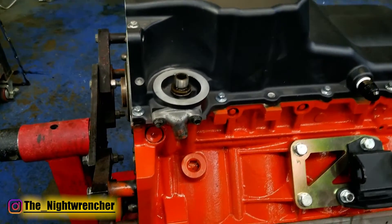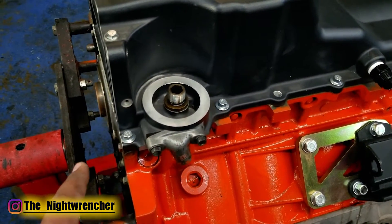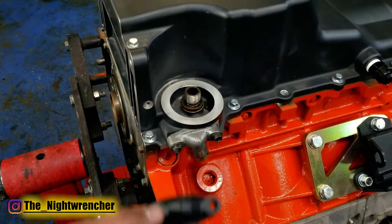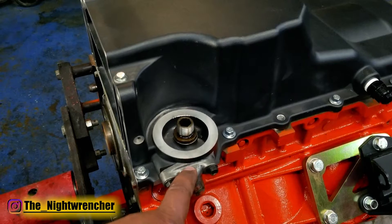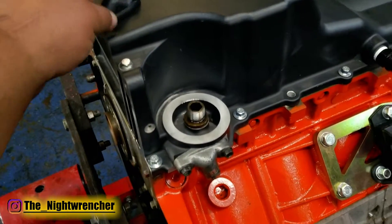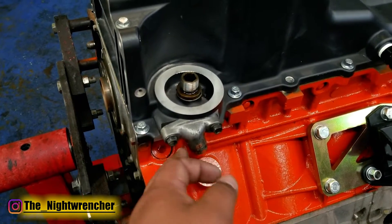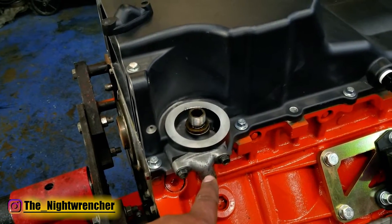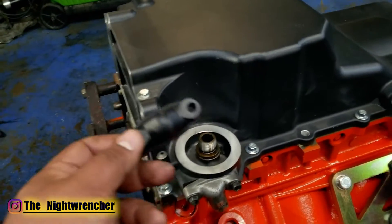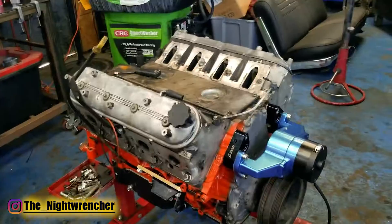Right before I flipped the engine over I actually realized a mistake with the bypass block-off. I double checked the package and assumed the pan didn't come with one, but as I was installing these motor mounts and moved some boxes out of the way I found the actual bypass block-off. We could take the stock one off and install this new one, but what I'm thinking is to keep the stock one on hand because there is a hole that is not tapped inside of this bypass — you can actually use that fitting to feed a turbo oil pressure gauge or whatever. In any other situation I would definitely install the one that came with the pan over the stock one.